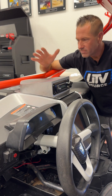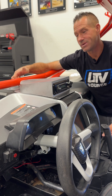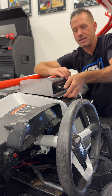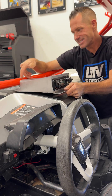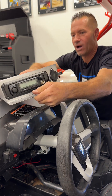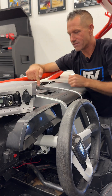You need to get to your fuses, which are located right here on the Segway Villain. It's pretty simple — you remove your two pin pops, pick up on the plate, the plunger or the plastic finger that engages releases, it slides out, and you rotate it out and over. See, everything is right here for your fuse box.